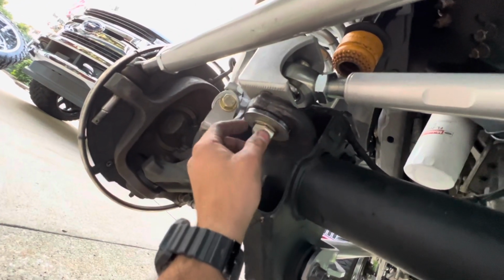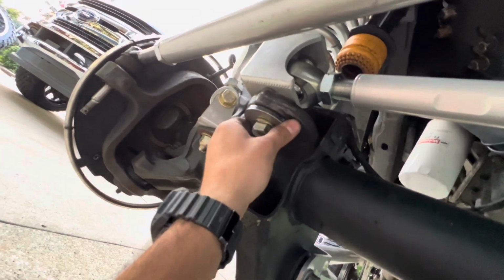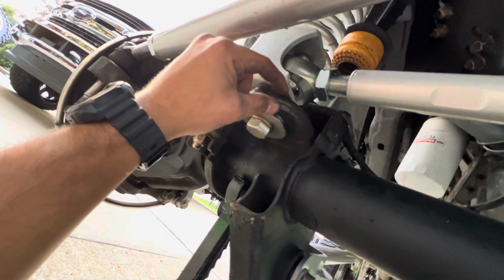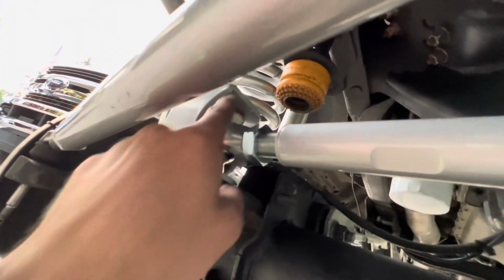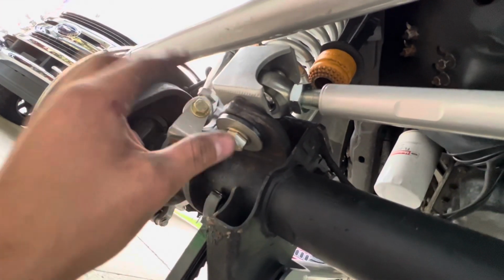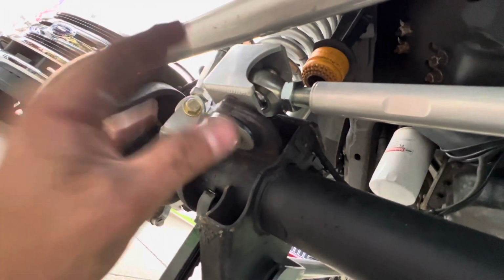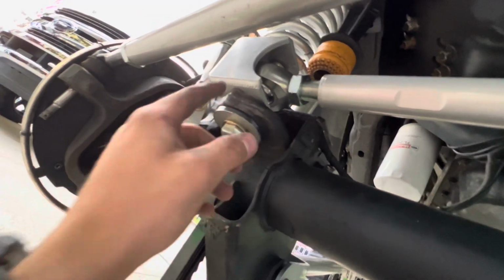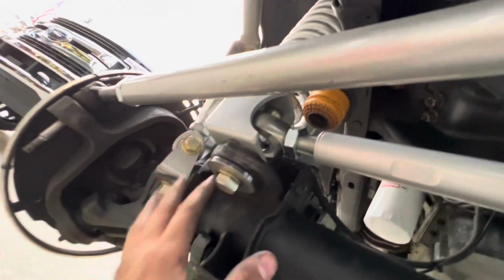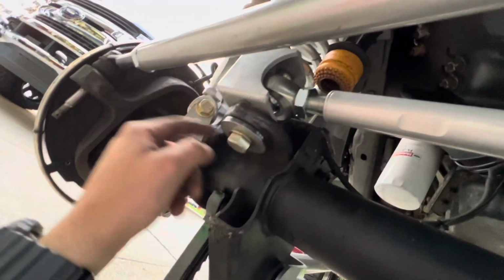When it comes together, you know, the bolt head, grade 8 washer, this thick washer, the thick bearing spacer, and then it'll come all like this. Not powder coated, but like this. So I put the little spacer in the freezer for a few hours. As soon as you can, take that out. Right away you take it out, come over here and pop it in. So I didn't have to press it in. I just dropped it in through the top, gave it a couple taps of a hammer, and then that's it.